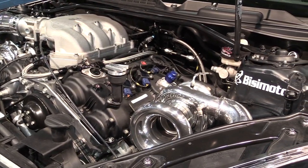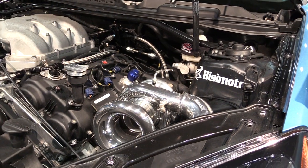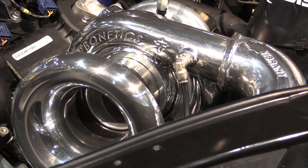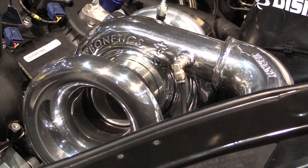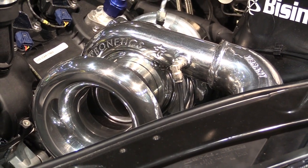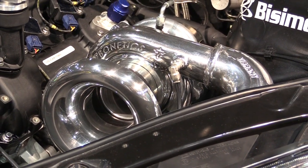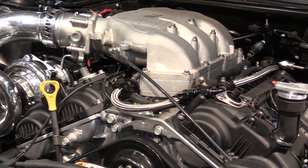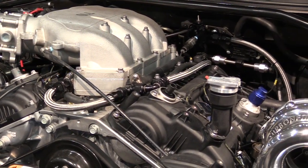Let's talk about those turbochargers — you've gone with a twin turbo setup. They are known as the BTX6162. Billet turbos on the compressor side, 61mm billets to be exact. The exhaust side has 62mm Inconel exhaust wheels. The turbine housing on the exhaust side is .63 AR. I wanted something that provides good enough spool to be an enjoyable street vehicle, but also has the potential to not choke up top and provide the flow to create big horsepower numbers.